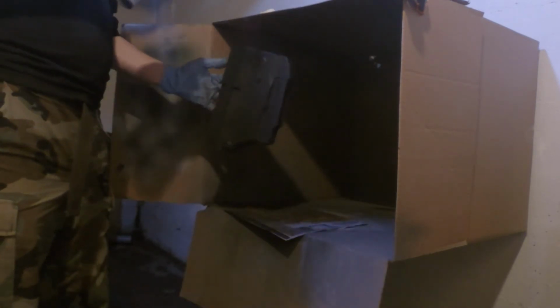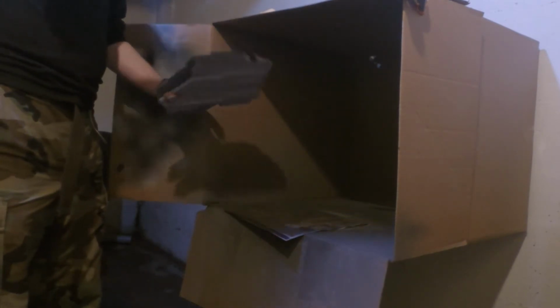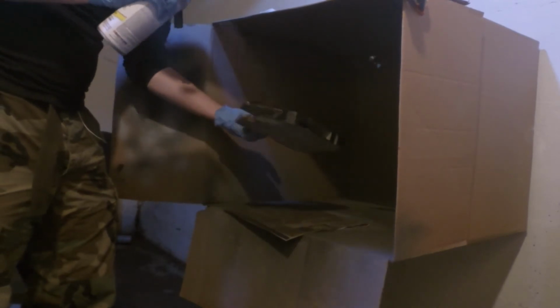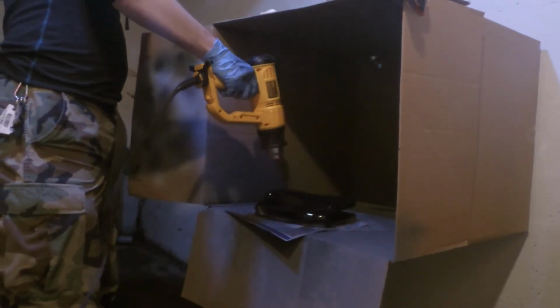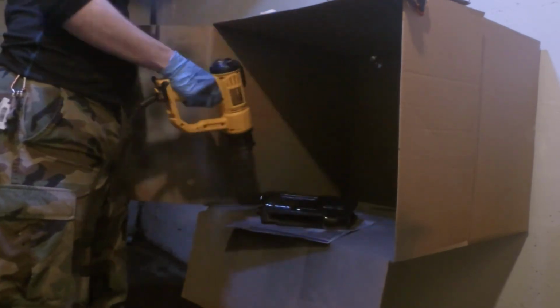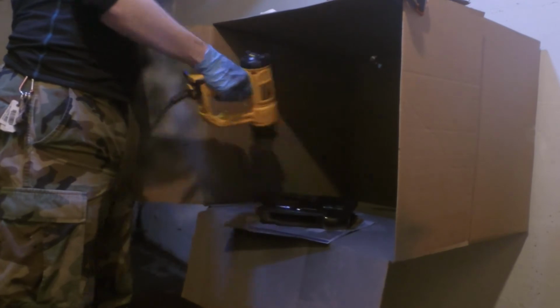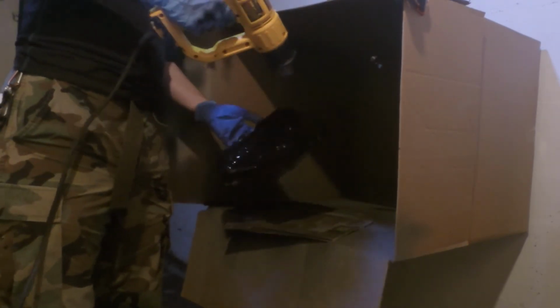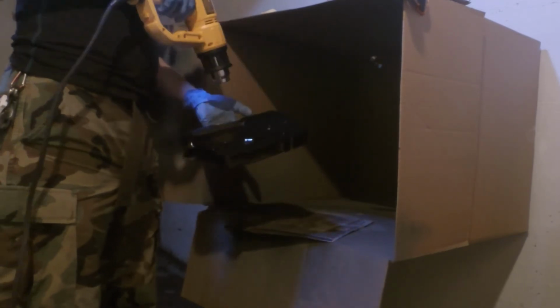The trick to applying Clearcoat is understanding that it's self-leveling. It naturally wants to form a flat, smooth surface. You just have to let it. There's a very fine line, though, between smooth surface and actual puddles, which obviously have the little creases along the sides. The best way to do it is in 2 passes. The first pass is very light, and you allow it to look a little bit pebbly on the surface. And then you come through with a second light pass, and in theory, those droplets should link up with the first droplets and create a single contiguous layer. And it should look essentially like a piece of glass over the surface. Sometimes it might need a third pass, depending on how light your coats are. But you've got to go very carefully.